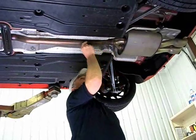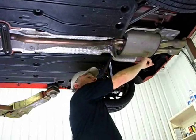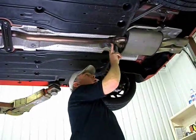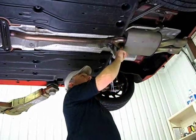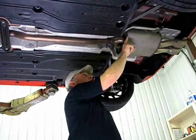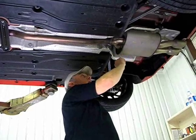On the Supersprint, we've got a better design where we're going in with 2, and there's a larger Y section inside the muffler that splits out into 2. It gives you a little bit more of a free flow characteristic right out the back of the vehicle. The can is also a crimped rolled edge design, which, if there's ever any leaks, when these edges are not welded and it's just rolled over like a coffee can, they will leak at some point.